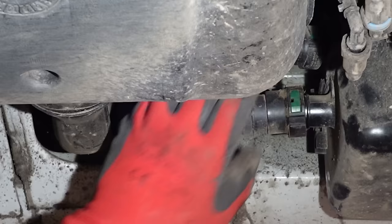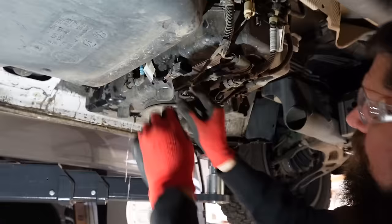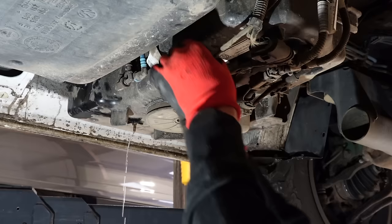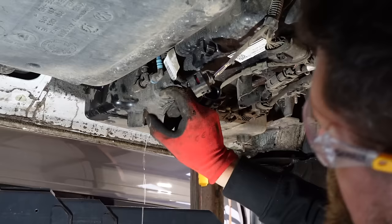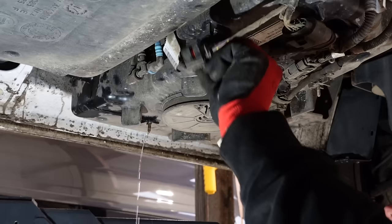There's a clip to remove the ad blue line - there will be some fluid in there, you will get some splash. It's like a standard fuel pipe fitting with two little push buttons. VW have made it quite easy - you can disconnect the electrical parts for the sender unit here rather than trying to do it on top of the tank. You've also got the two fuel feeds - fuel feed and fuel return - that you can disconnect. Squeeze and push, then pull them apart.